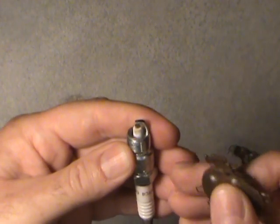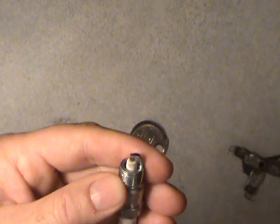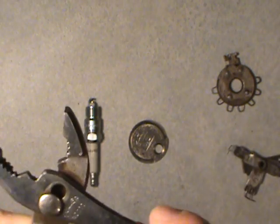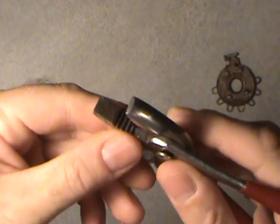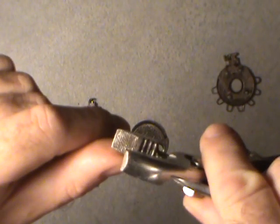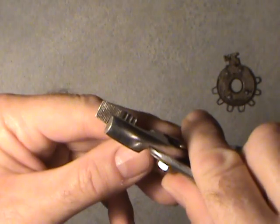What I found was half the time I end up touching the inner porcelain that surrounds the inner electrode, and possibly the inner electrode itself — and you don't want to be touching that in any way, shape, or form. So what I've come up with for adjustment is very simple: it's just a pair of slip-joint pliers. In here on the end, and also on the other side, there are serrations which will help you grab what you're working with. That's the one I'd recommend — something with serrations that will grip, not just flat and shiny where it'll slip on you.